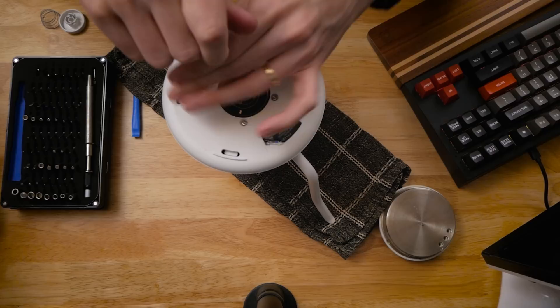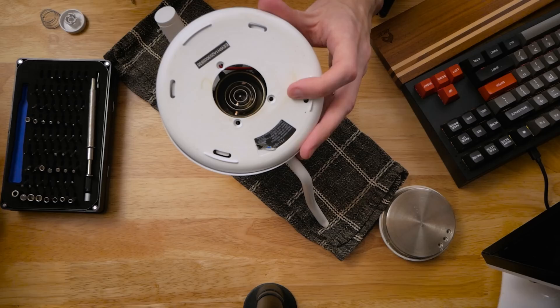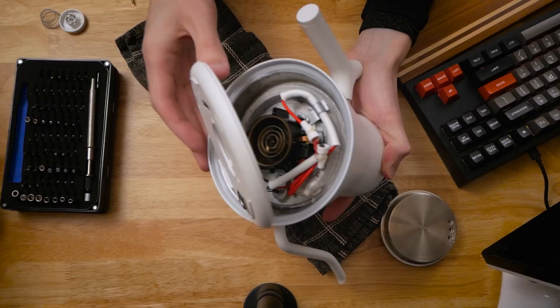Let's fix this kettle. But before I do, please be careful and do this repair at your own risk — know that it will void your warranty if it isn't already outside of the warranty period. For this fix, we need to replace the thermal fuse. To get into the base, I used a 2mm and a 3mm triangle bit. One of the screw heads was just a little too small for the 3mm bit. You can also use a Torx T7 and T8 in a pinch, but make sure you have a couple different ones in case the screw heads are inconsistent. When you open up the bottom, be careful because there's a blue wire attached to it that can come loose pretty easily. You'll see a white sheath clamped down on the red wire — that is where the fuse is.